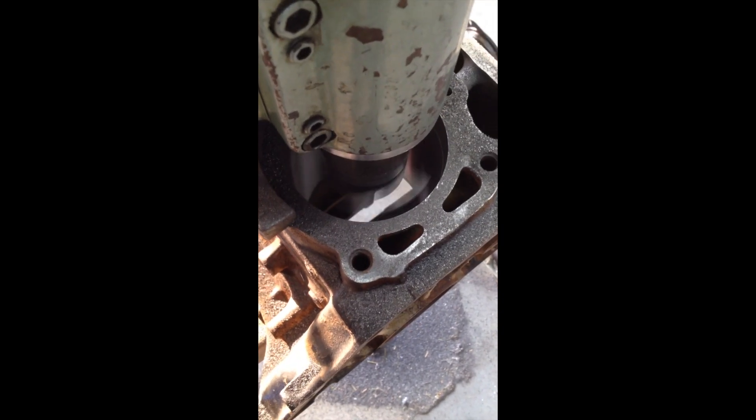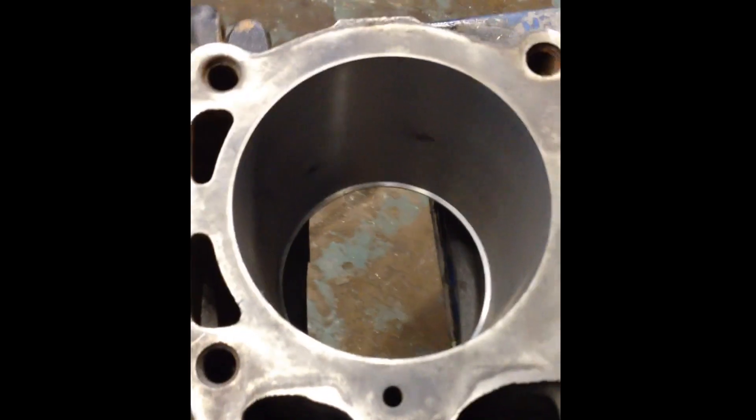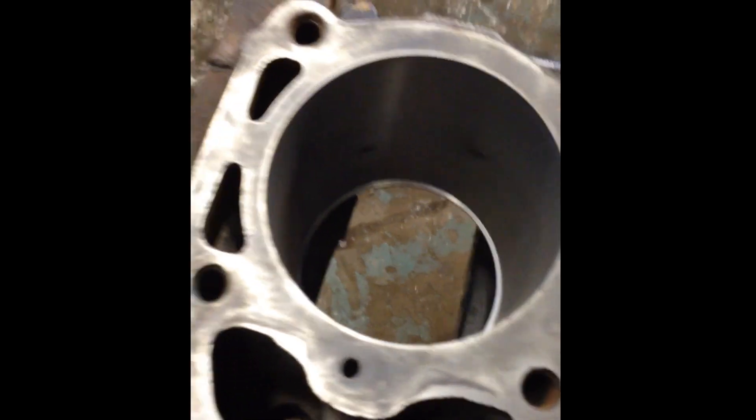This is the fourth pass on this — we'll have cut out 80 thousandths total, with about 80 more to go. This is basically your engine sleeve. He cuts down the cylinder walls for that to fit in there, and then you cut the inside of the sleeve down and make it fit after you install it. We've got the counterbore done for the sleeve — it's actually about 4 thousandths smaller than the actual sleeve — and we're going to see if we can press it in.